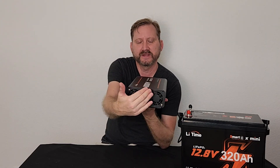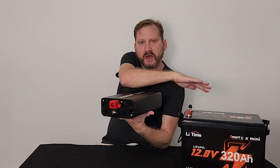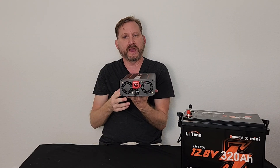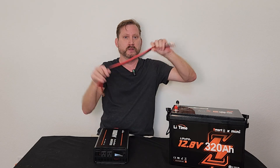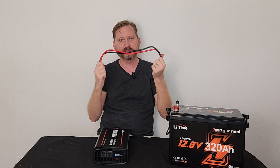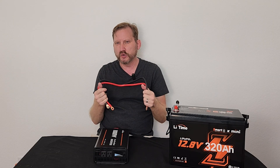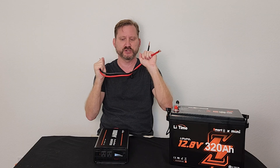What I like about this unit is the battery terminals are stacked as opposed to being on either side. So if you've got different configurations of your batteries, you don't have to worry about having your wires crossed — I could just drop this on top and run my wires to either side. This unit does come with wires. The manual says 8 gauge, but they actually sent me 6 gauge. I would still move up to a 4 or maybe a 2, but they're really nice and flexible, decent quality, and this will certainly get you started.